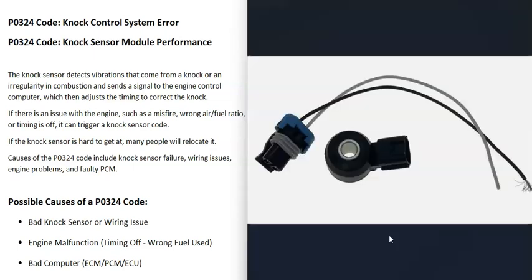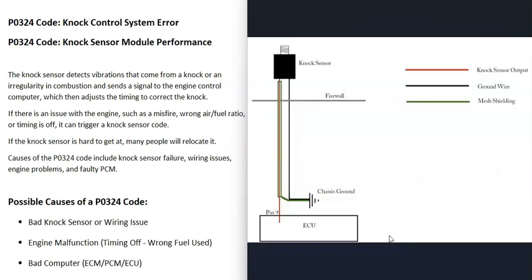There are some different ways to test those knock sensors — there are good videos on it. These sensors can be tested to see if they have gone bad. You can also get a wiring schematic for your particular vehicle, since there will be differences, and check to be sure that the wiring is good — no open, no short, or anything like that going back to the computer.